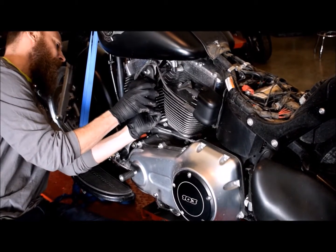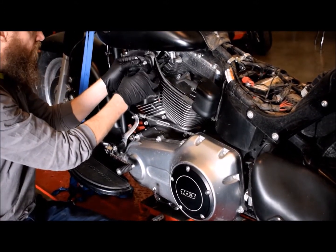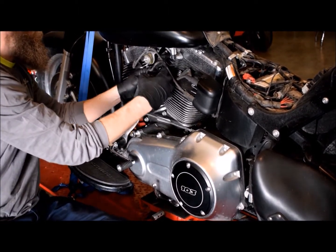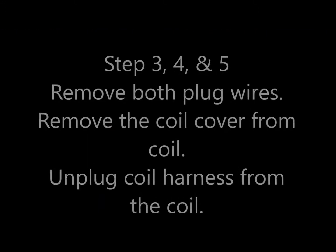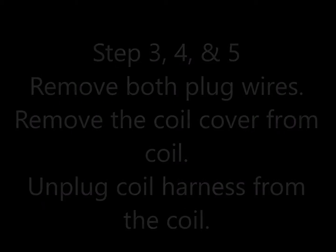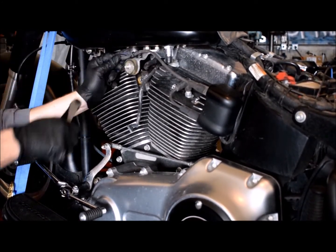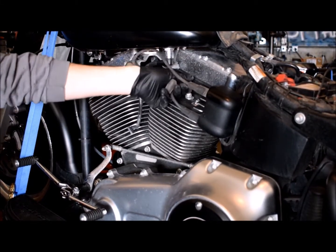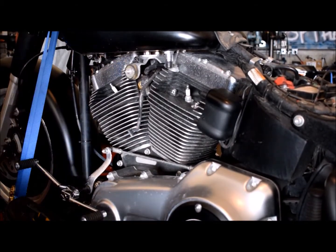All right. Pull the wires out of the cowbell. Yep, right there. Retain the rubber. We snip the zip tie stuff on the top of the motor mount. Free up the spark plug wire and pop them both off. Now watch, he'll twist and pull, and those things come right out.